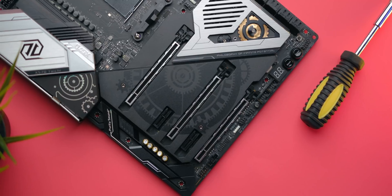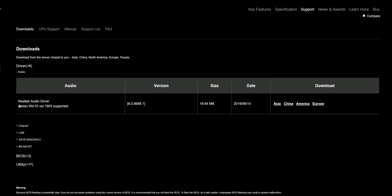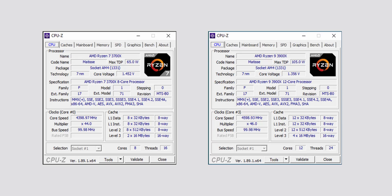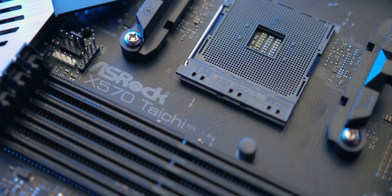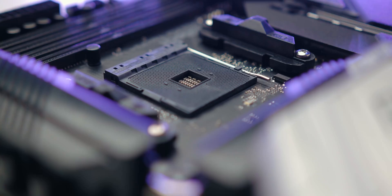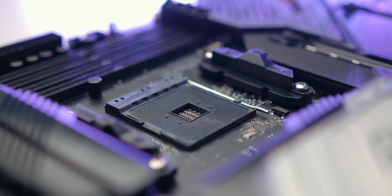Some people were actually reporting even lower clock speeds than those. We figured this out early in our testing process, but without a functional BIOS available at the time there wasn't much we could do. New BIOSes are now being rolled out with AGESA 1.0.0.3AB, which is supposed to fix these core boosting issues. We've tested four motherboards — the X570 Tai Chi, the Aorus X570 Master, the Aorus X570i Pro Wi-Fi, and the MSI X570 MEG Ace — and with the latest BIOSes they all work well. However, we've heard from consumers using X570, X470, X370, B450, and B350 boards who say their chips still aren't boosting properly even with the latest BIOS.